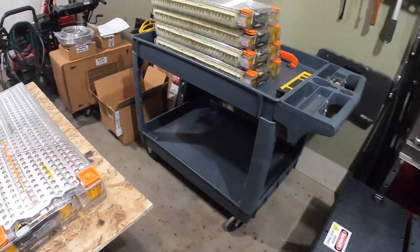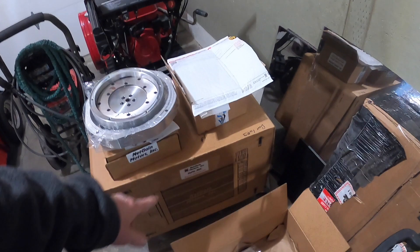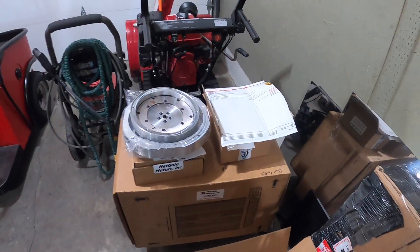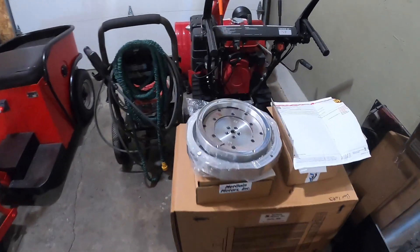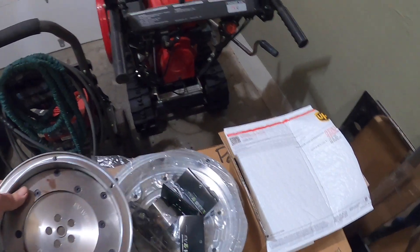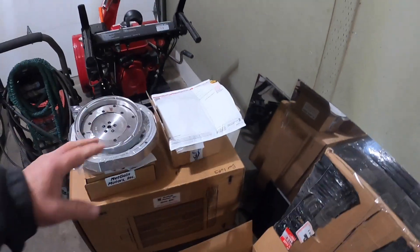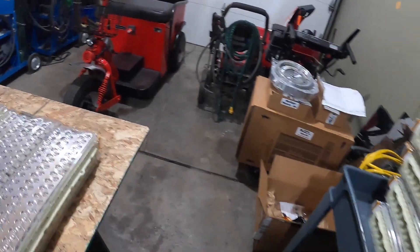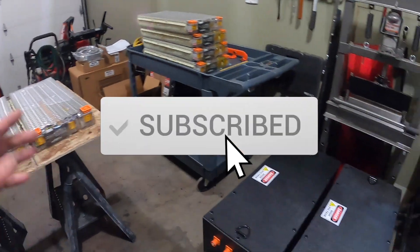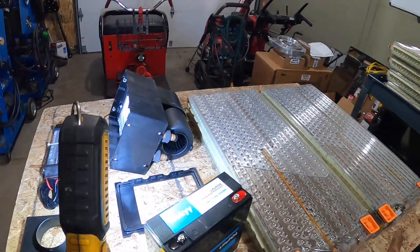At least I got the battery boxes all done. I do have the net gain permanent magnet-type motor, which is similar to a Model 3 Tesla — that's going to be 120 horsepower, like 200 foot-pounds of torque. This is a high-voltage Hyper 9 that'll go up to 180 volts — I'll be running about 150. I just got in the light flywheel from EV West, which is really nice — a light flywheel instead of a big honking Volkswagen flywheel — and also the motor adapter and motor controller. Slowly the parts are coming in, and we'll take it up from there in part 7. Please like, share, and subscribe. If you have any comments on stuff I did wrong, stuff I did right, or any questions if you're going to tackle one of these projects, let me know. Thanks for watching.